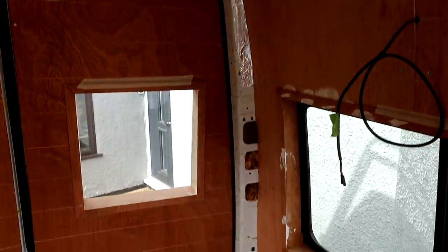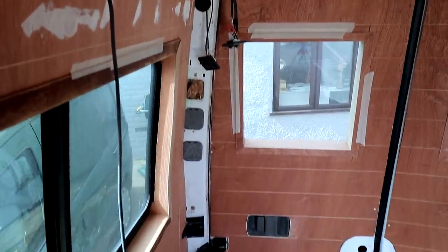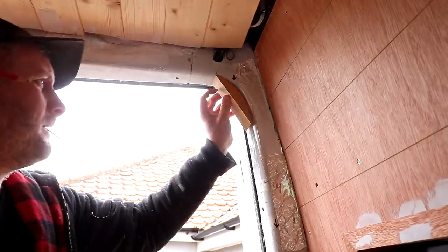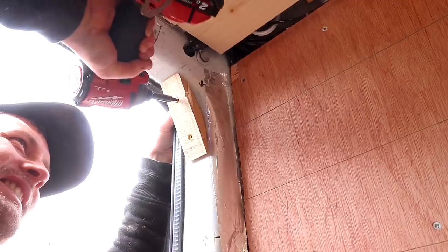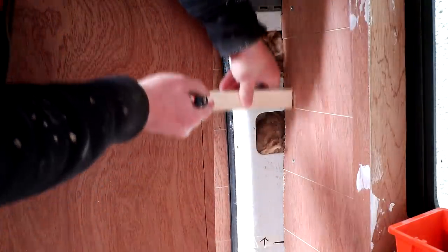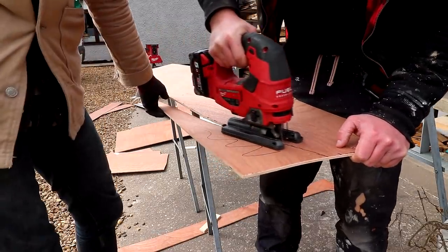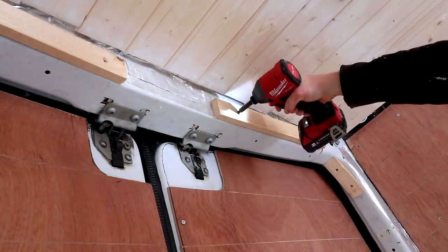The next job was to box in the pillars on either side of the doors. The easiest way to hide these would be to use carpet and some spray adhesive, which is what most people tend to do, but the client wanted these ones boxed in. We made up some blocks to ease the transition of the top corners to a shape we can bend the plywood to, and we can screw those directly into the metal. We offer up a piece of plywood, making sure it's sitting straight on the floor, scribe the shape of the wall onto it using a block of wood, then cut it out with a jigsaw. We then mounted a few more blocks around the pillars to give us more material to fix to.